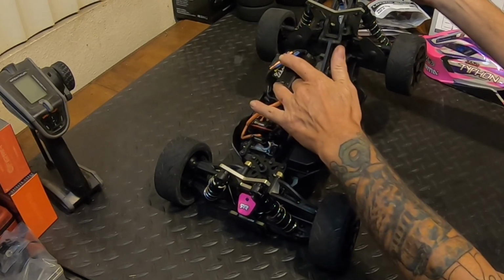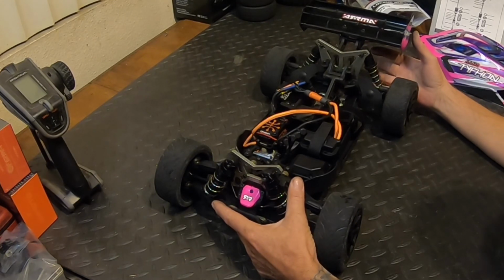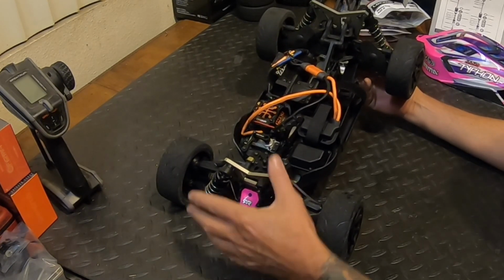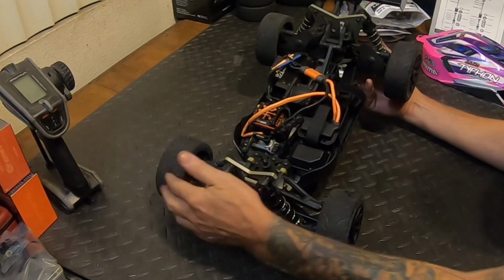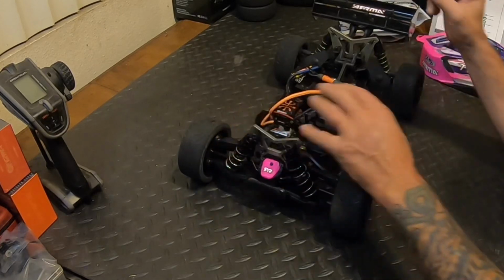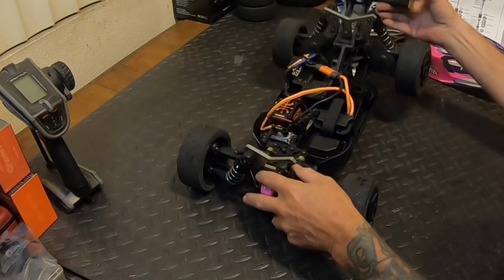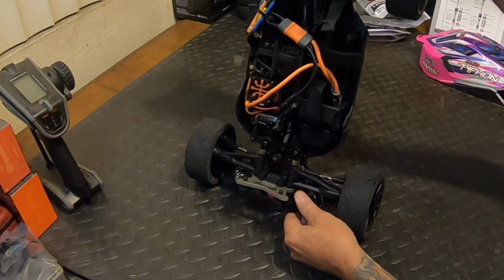If this is thin, then it's going to want to dip out and bring this down right away. If you have the wheel speed there, if the fluid is thick, it's driving all four wheels at the same speed. So when these land on the ground and these start driving like a front wheel drive car, it's going to suck this down immediately as soon as you hit the ground. Thinner fluid, if you land like this and it tries to drive, it's going to slip a little and this is going to set down slowly. So it all depends on how far you land on the front wheels.